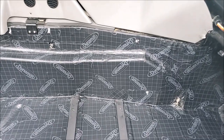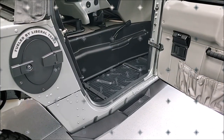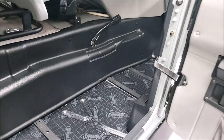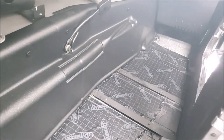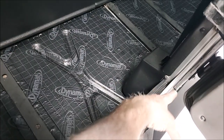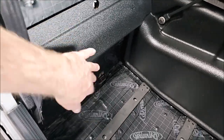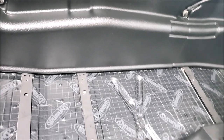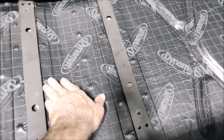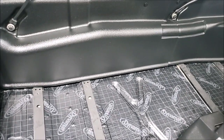I'm getting started on putting the interior panels back in. I've got pretty much all the panels in on the passenger side and it looks really good. I got the inside kick panels, the seat belt retractor cover — I'll wait on the back ones since the carpet goes up behind them, so I'll do those three little pieces last. The next thing to do is put the neoprene padding down where the old mat was to fill in the low spot, bringing it up to flush level so the carpet kit will sit flat all the way down.